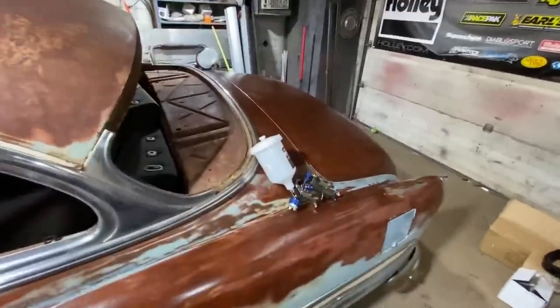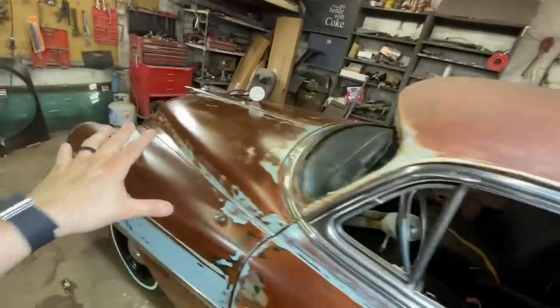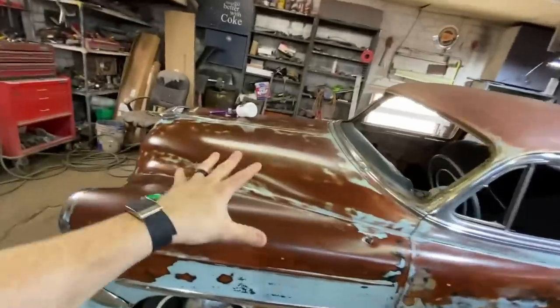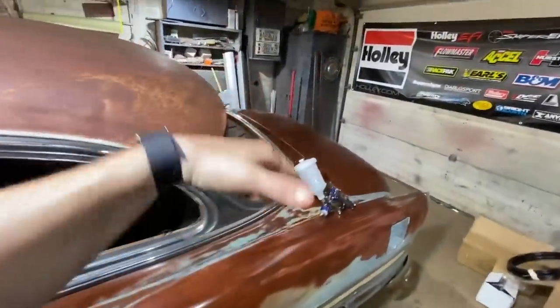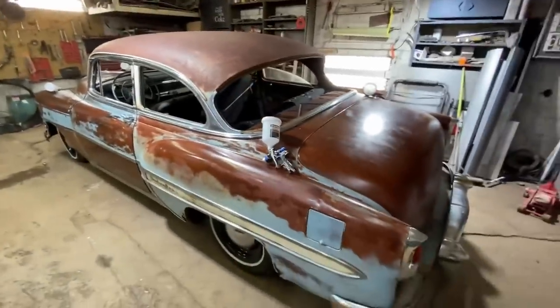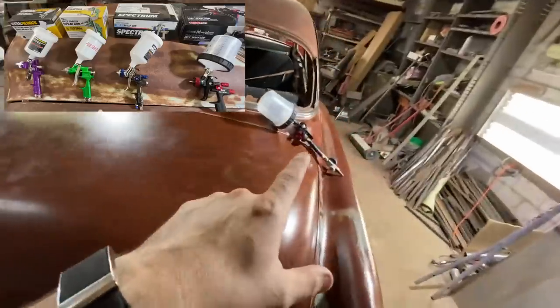We're going to try those in a different video, but just a nicer HVLP compared to the cheaper guns. You can just see a difference in the air. These just fog out your whole shop when you're painting with them. These get a lot more paint onto the panel versus just being airborne. It just doesn't take the air pressure that the other ones need. And it looks perfect. I will say though, the Black Widow is probably the nicest gun I've ever used.